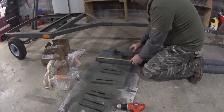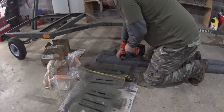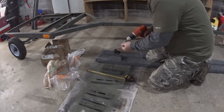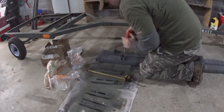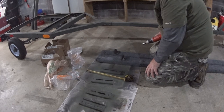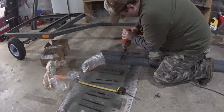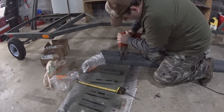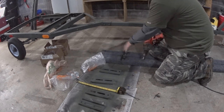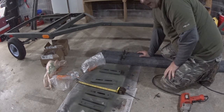I'm going to go 11 inches instead of 12. You want to drill a pilot hole first. The size of this bolt is 9/16ths. My drill was too weak so I got the hammer drill out for this. I did one side and then the other until they were both tightened down. The easy part's done — the more difficult part is sizing it for the rest of the trailer.